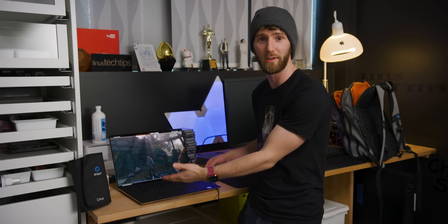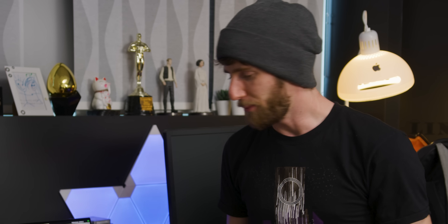Another thing to note is that this config isn't optimal either, because some of the cable's bandwidth is being used to bring the image back from the eGPU to this display. We would actually see a definite improvement if we were to plug directly into our eGPU for the display output — but then I couldn't just go put it wherever; I would have to put it where I actually want to game, and I'd just be able to put the computer wherever.